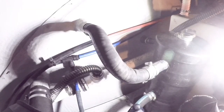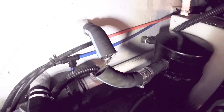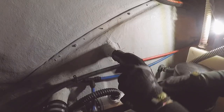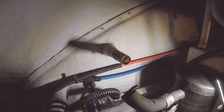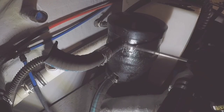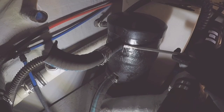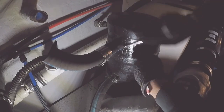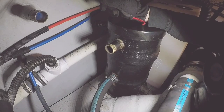Let's see if we can get this one off — I'm going to try cutting it in the middle like the other one; that seemed to work and makes twisting easier. The adhesive that the manufacturer installed on the hoses really helped with keeping them from leaking, but made it nearly impossible to pull the hoses off the fittings. I consulted some other boat owners, and from my past experience I never added any additional adhesive to hoses like this. Getting behind the hose for leverage and breaking some of that glue helps — you can hear it snap. That's two down, three to go. It spins right off. Three down, one to go.